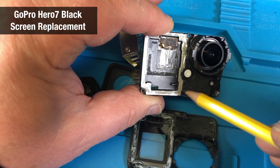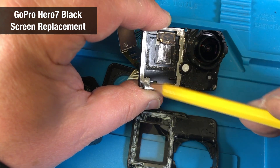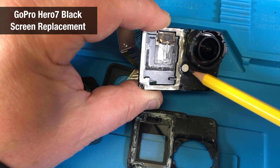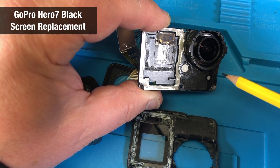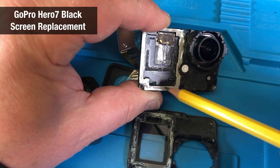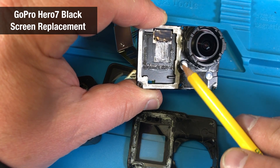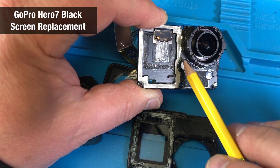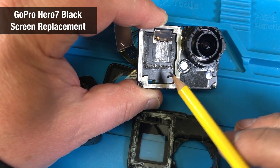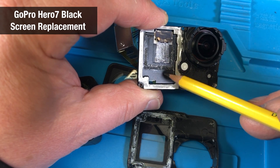Around the front display here it was glued with some RTV or whatever it's called — a very high bond glue. This makes it waterproof. This display area is waterproof, so you can get water in here and here and here, but just not in there. As I was going in with the screwdriver at this spot to push through and break the seal open, I got too far to the left.